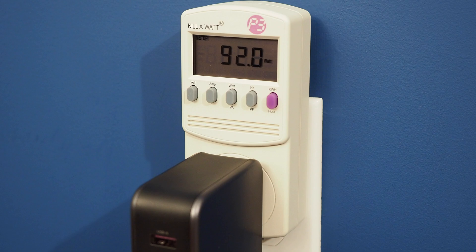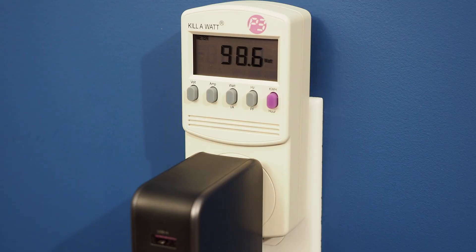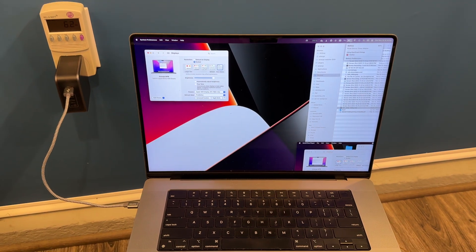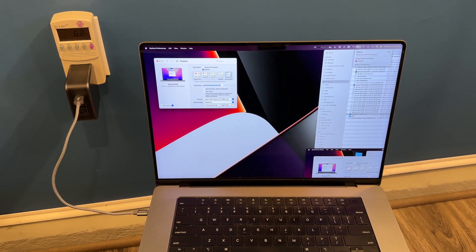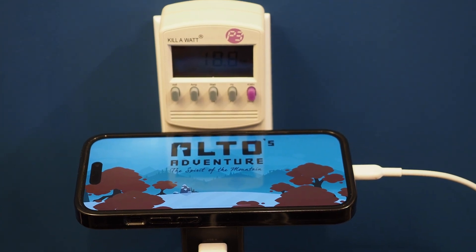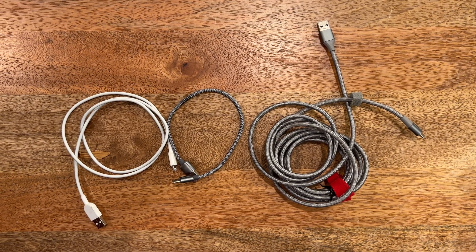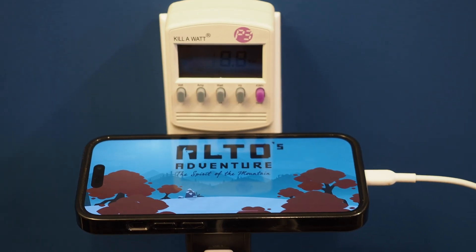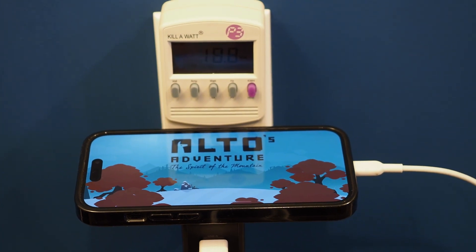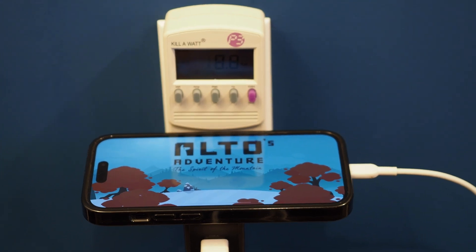Using my Kill-a-Watt power meter, the 2017 MacBook only draws a mere 30 watts tops. The 16-inch MacBook Pro draws about 90 watts, and so does the M1 Max but just a bit more — despite being a 14-inch laptop, likely due to the larger GPU. When I tested the USB-A port it would only deliver between 6 to about 10 or 11 watts maximum across my three laptops and iPhone. It seems capable of keeping an iOS device charged overnight, but that's still not as good as the advertised 22 watts.